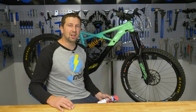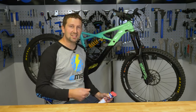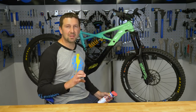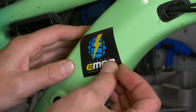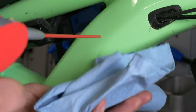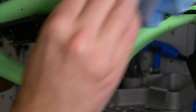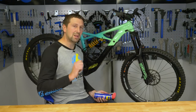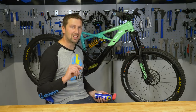We all love putting stickers on our e-bikes. Some of you might have bought a new one and had manufacturers' stickers, warning labels, things that you can peel off if you want to. But sometimes they leave horrible sticky residues, and as soon as you're riding or any dirt gets on there, it will just stick. I suggest just squirting a bit of WD-40 on there, rub that down nice and gently. Just be really careful not to contaminate anything like brake pads, and be aware it's obviously very flammable too. Scrub that in, let it soak if it's really stubborn, and I guarantee that gunk is going to disappear.